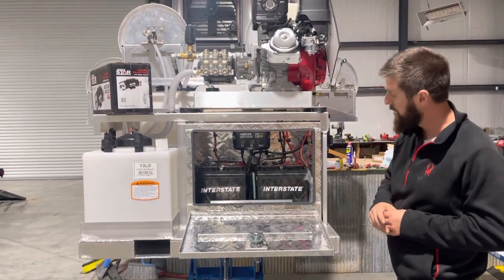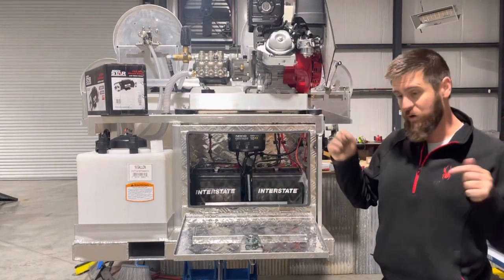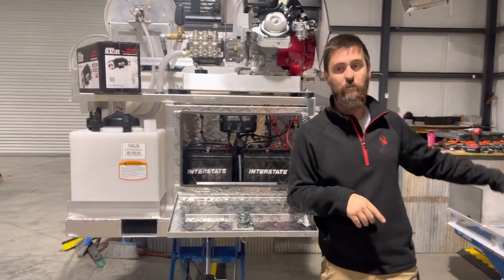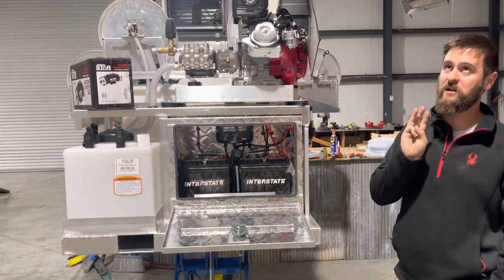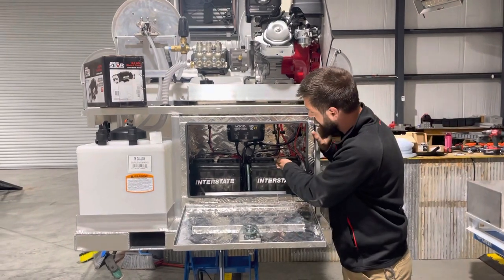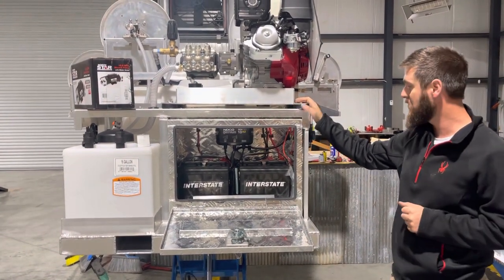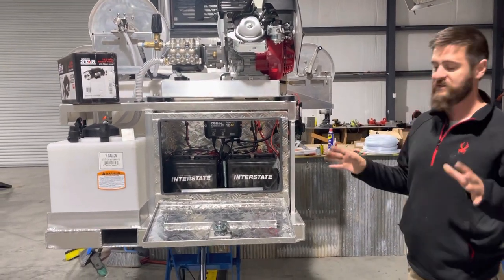The other thing is you'll need a battery charger that can handle that. NOCO — we don't carry all of them, but you can get them online. A NOCO Gen 3, a three bank, would handle that — you'd have one charging bank going over here and two going over here. There are four or five different ways you could set up the electrical, but that's the gist of it. All of this other stuff — the switches and all that — no need to change. They'll be the same.